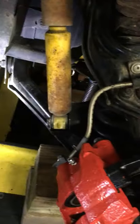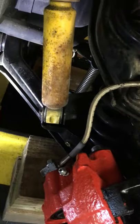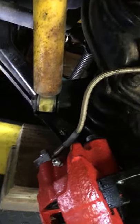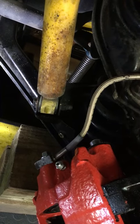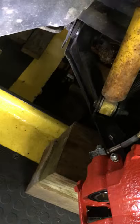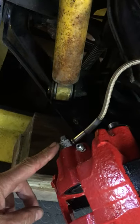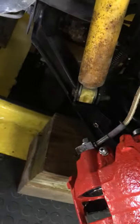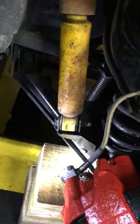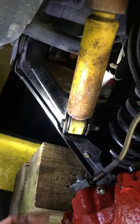A lot of guys probably don't even check for that at full lock. I took a multi-faceted approach to resolve it. First, I used a die grinder to grind a notch in the shock absorber so the head of that bolt fits right into it as the wheel turns, allowing it to turn farther. Second, I took about 300 thousandths off the surface where the brake line attaches, giving me almost another three-eighths of an inch.